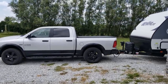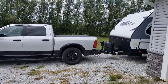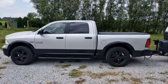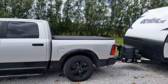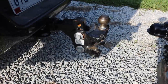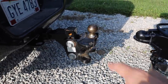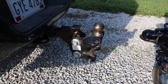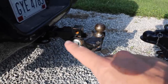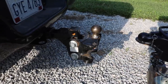We are pulling a 35-foot travel trailer with a tongue weight of about 700-750 pounds with very minimal squat. So it is possible to do with a half-ton truck. One of the most important things to have is a good weight distribution hitch. It's going to help you tow safely, keep the truck and the trailer level, and evenly distribute the weight between the frame of the truck and the frame of the trailer.